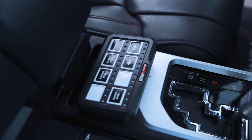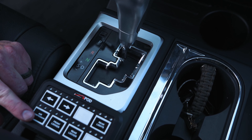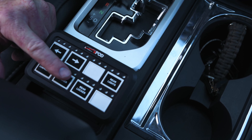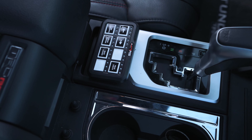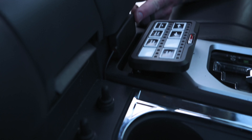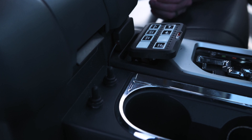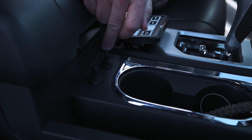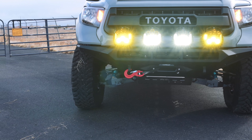As mentioned earlier, the S-Pod is the HD unit with rubberized switches so you don't have to take your eyes off the road to know which switch to engage. This is left side roof rack, right side roof rack, ARB compressor — which you can leave on when you're on the trail — rear locker, front locker. If you've got those memorized you can just operate them that way, and the far right is your rear lights for backing up. You never really have to look at it — you can just reach down and feel which switch is which. The WeBoost system internal antenna is mounted right here so it's out of the way and centralized in the truck. These are the switches for the LP9s up front — low power and high power, with off in the middle. This is nice while driving because your arm can rest on the armrest with your hand right next to the switches.